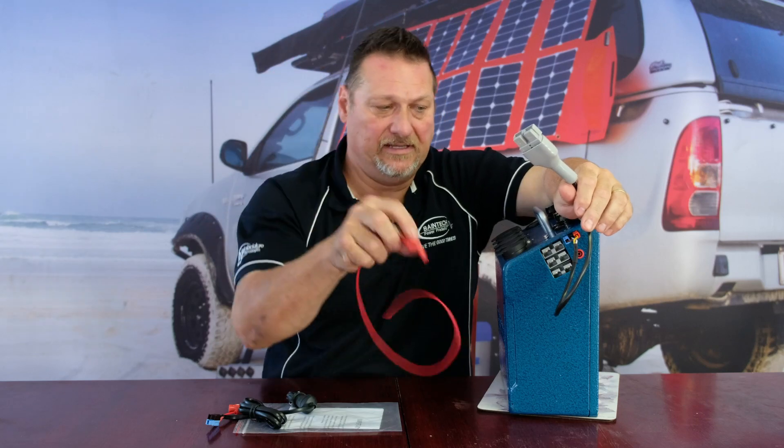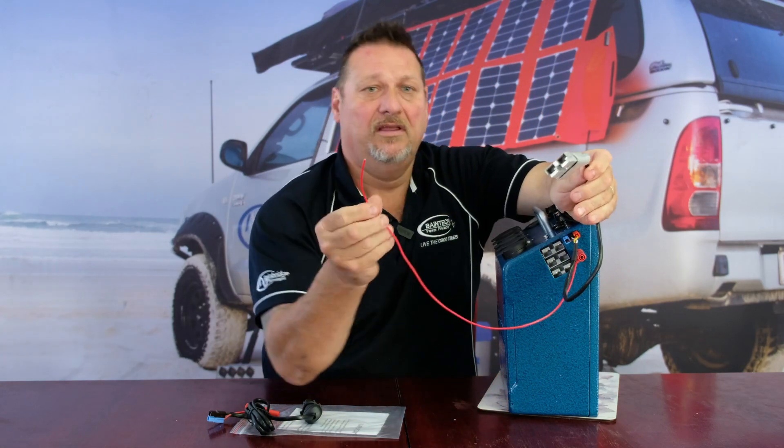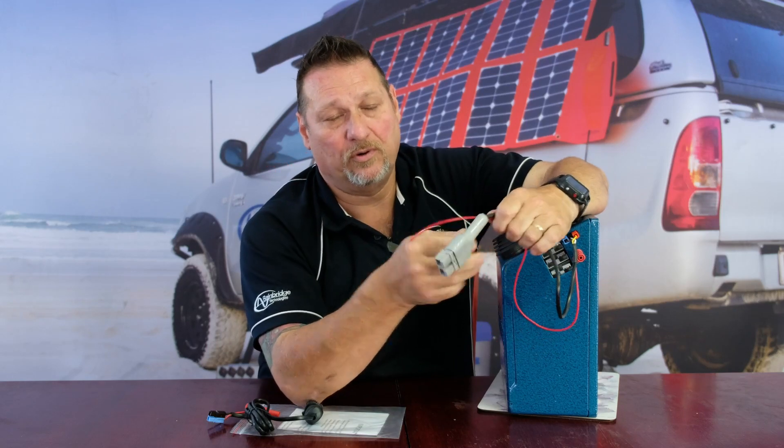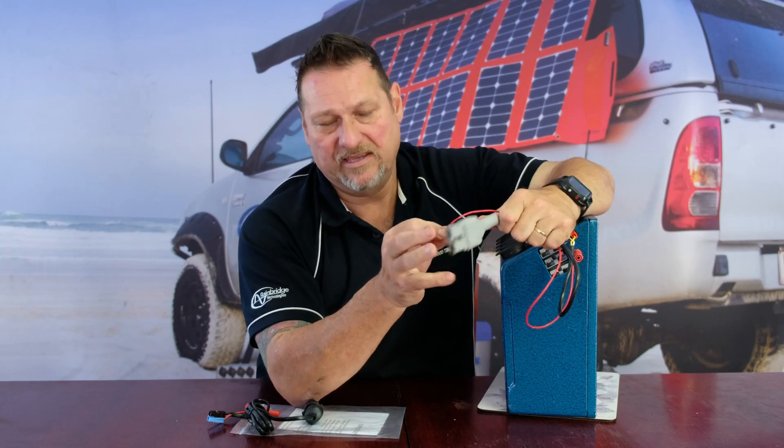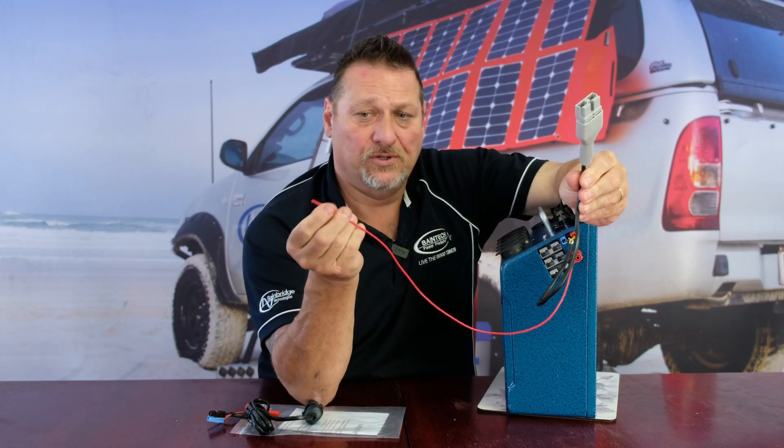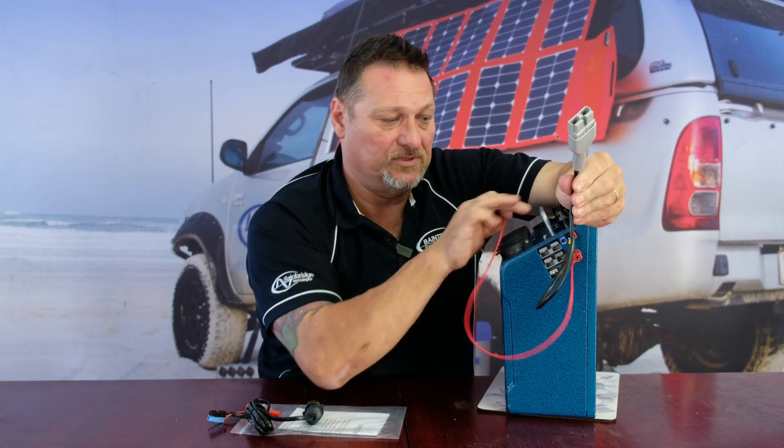To alleviate that, we've now included this little lead here which plugs into this little red port. When you run the cable from the front of your car under the bonnet, you need to connect it to somewhere in the fuse block in the engine bay — there'll be a circuit controlled via the ignition key, such as an ignition or fuel pump circuit. An auto electrician can do that for you if you're not comfortable. This means the unit won't turn on until this plug receives power, so it will only draw power from your battery when the ignition is on, and disengage when it's off so it won't flatten your front battery.